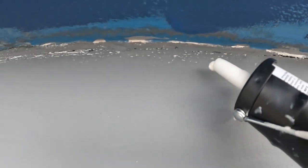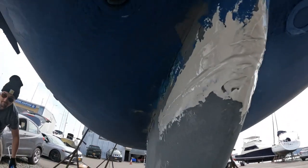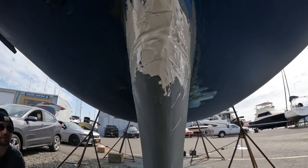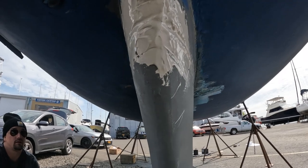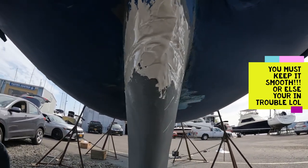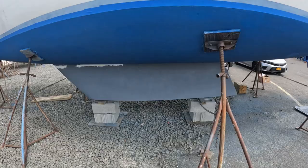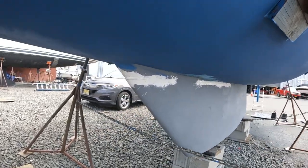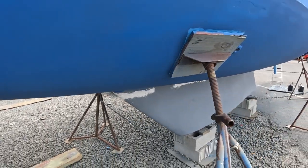We're going to 5200 this joint, smooth it out, and then start fairing. Right there is where we start — bring it down smooth, smooth, smooth, thick. We filled the joint with the 5200; we're going to do a little bit more and let it set. The trick with this stuff is, because once it dries it's not sandable, make sure you're smoothing it the best you can. Then it'll set up and you can fair over it. You want to smooth it as best as possible because this is not sandable. Smooth it out and then we'll start fairing. We're going to keep working that joint until it starts to tack, and then it's time to mix the fairing compound.